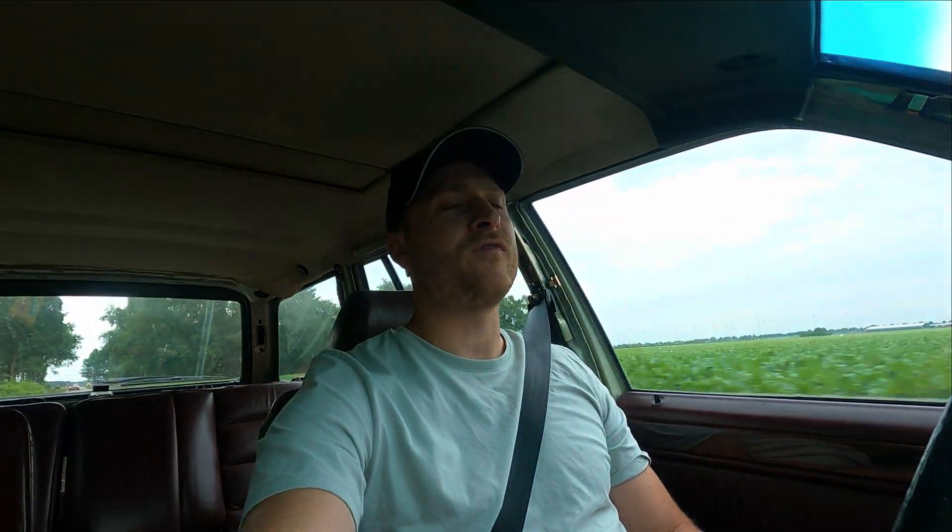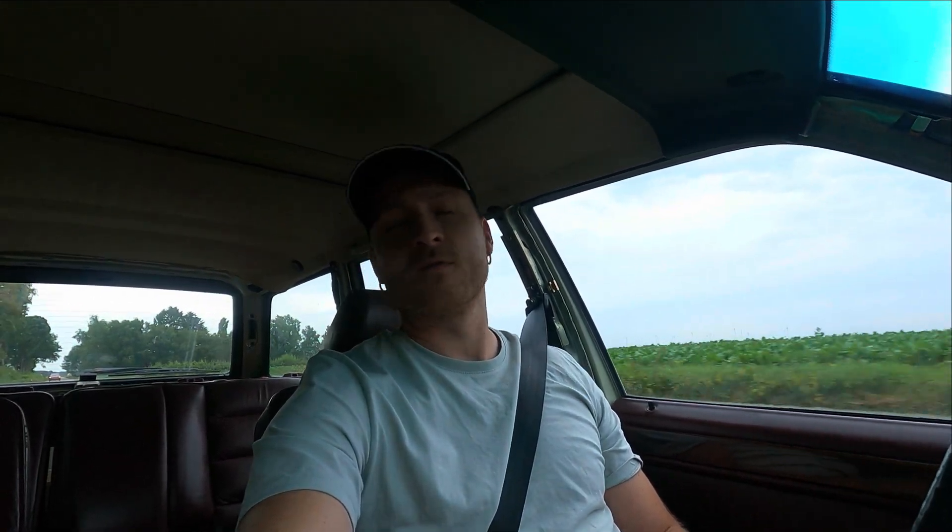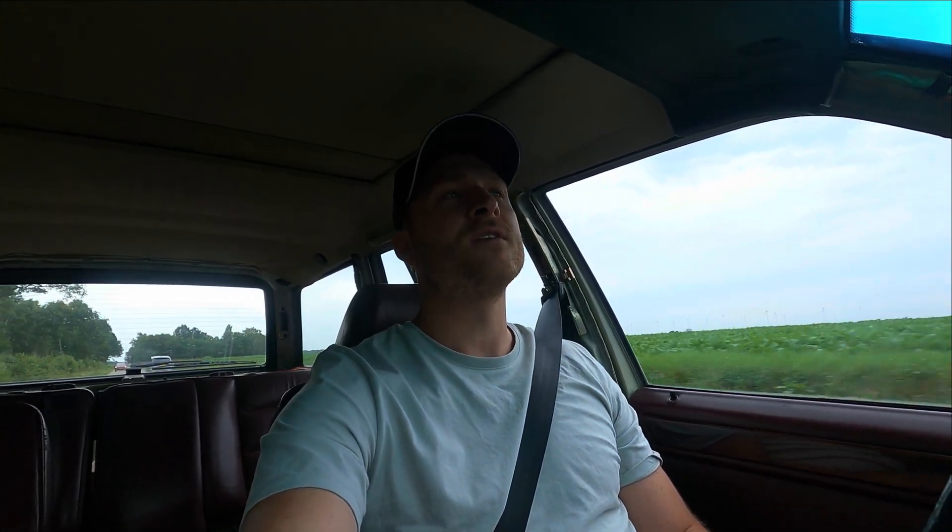I'll go on the dyno in one and a half months and then we'll do the fine tuning. When I look at the lambda and everything else, it's all spot on target or a little bit below — slightly richer, but only a very low percentage richer, so that's not really a problem. I'll put the camera in position so you can see, and do one pull, then go from there.